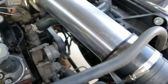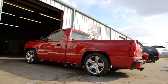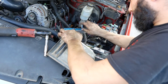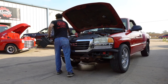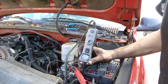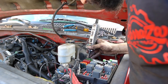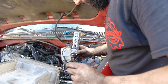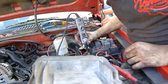So we're plugging in the e-fans, and this is the ground right here. Checking for power? Yeah. No power — you need ground. It's 11.9? Yeah, those are dead. I think these are dead. Yeah, do a key-on. Yeah, I think these are dead.